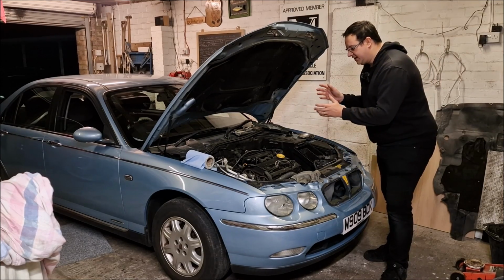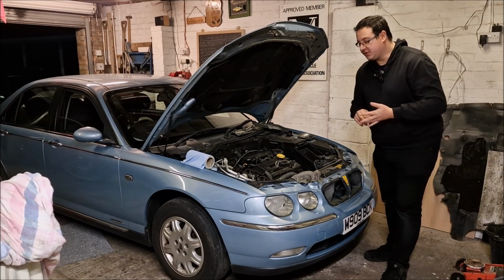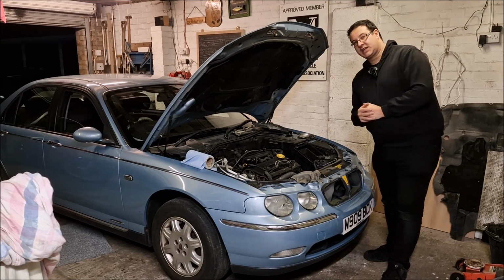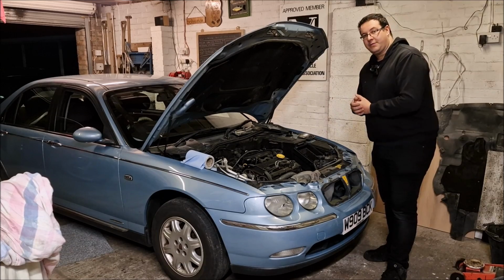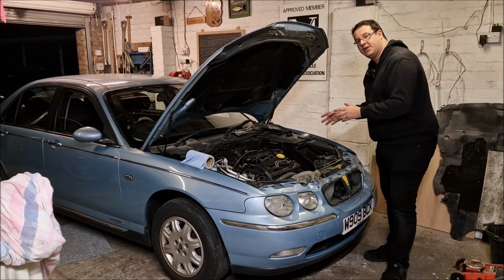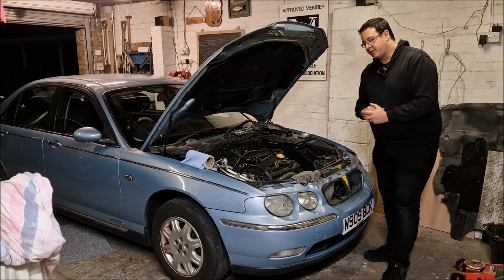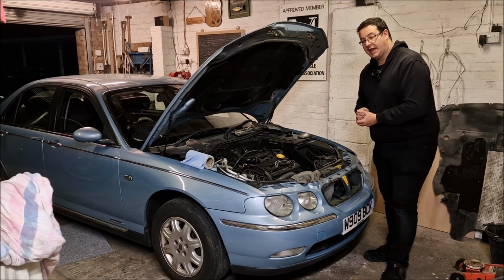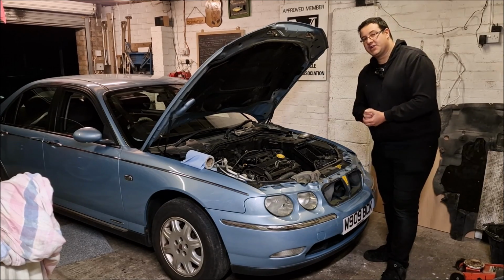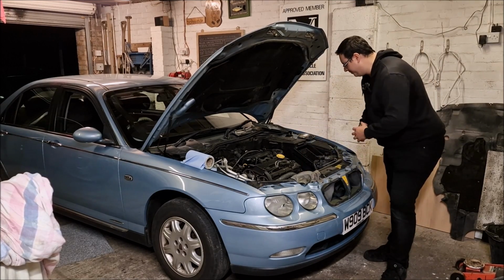Well, we've obviously done the cylinder leakage test on the engine, Dad and I, hot and cold, and have found no evidence that the head gasket was faulty. We've replaced the thermostat and everything is getting up to temperature. We've done onboard diagnostics and the water seems to be flowing fine round the system. There doesn't appear to be any blockages. The jiggle valve is free and the inlet manifold has been replaced. The water pump is fine. It's flowing nicely. The heater matrix has been unblocked and the system now is getting up to pressure.